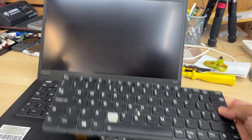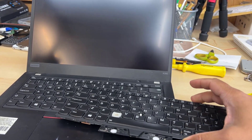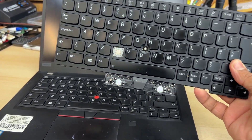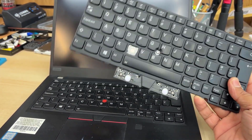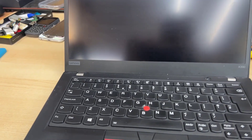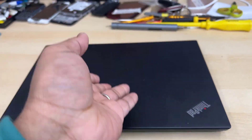That is the actual look. So I thought it's going to be like an ordinary keyboard replacement, but it wasn't. I'm going to show you what the difference is. This keyboard actually comes with right, left, and the center key. And under the right and left key, there are two screws which are hidden underneath the tab. So it's very easy to forget about this tab, and if you pull it, you're going to damage the existing keyboard and you wouldn't be able to replace it.